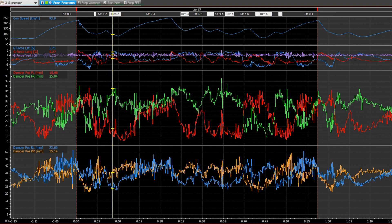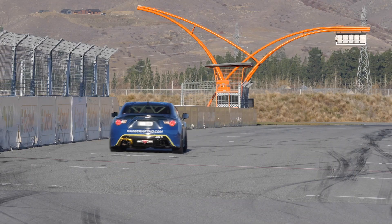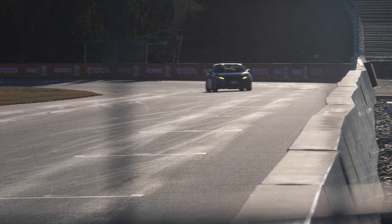This is really useful information when you are diagnosing handling problems on your car. Another useful way you can use damper potentiometer data is to estimate the level of downforce you are getting from your aero. As long as you know the stiffness of your springs and bump stops, when in the suspension travel your bump stops engage, how far they're moving, and the motion ratio between the wheel and the damper potentiometer data at each end of your car, you can get a pretty good estimate of how much downforce your car is generating on track.